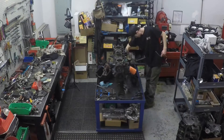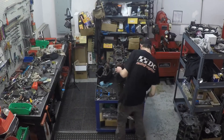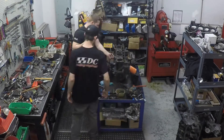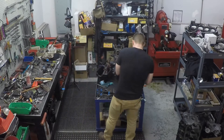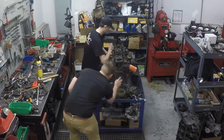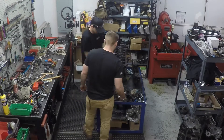Next came the belt drives and the harmonic balancer. Then we set about taking apart some miscellaneous bolts throughout the engine block — one in particular, as you can see, would just not come out. We tried a 12-point extractor nut, lubricant, and heat, but just couldn't get it out, so that was something we'd have to remove at a later date. We followed that up with the timing chain and timing chain cover.